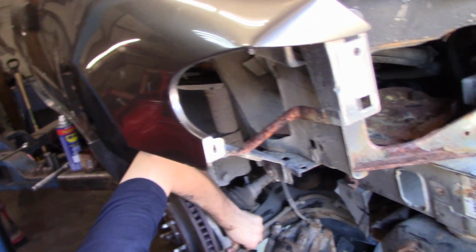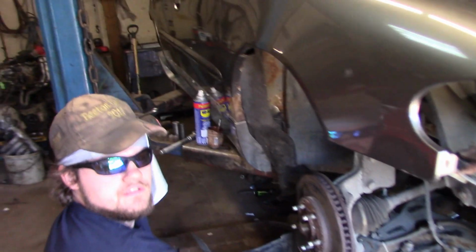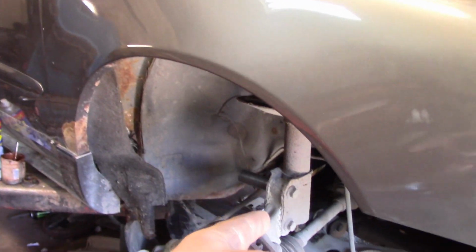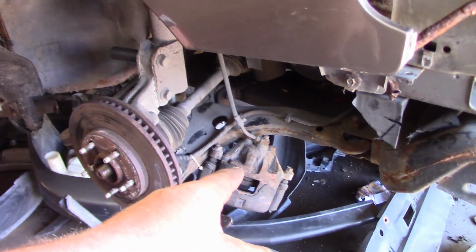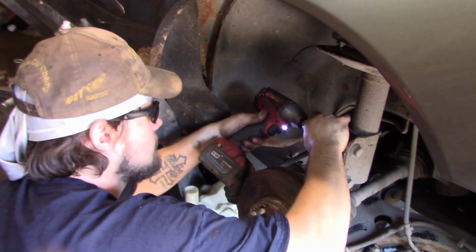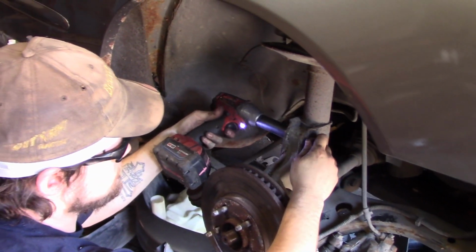But what we're doing is we're pulling the aluminum off, we're pulling the brake calipers off, we're pulling the discs off, we have to adjust the tie rods. The spindles I'm using, we have to re-drill the top hole for the actual strut, but it's not a big deal doing that. We leave the lower ball joint in, we let the caliper hang until we undo this brake line and thread it into the other one. Basically stuff like that. The axles can stay the same.